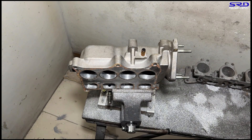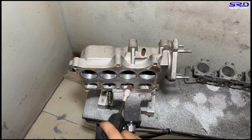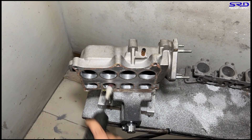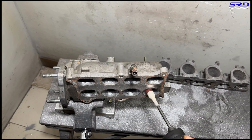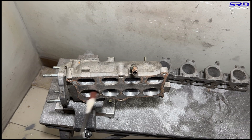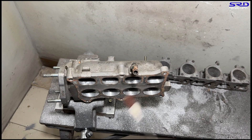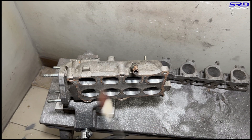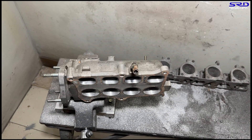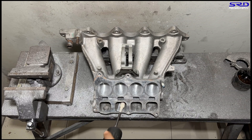This is the shorter runner side on the wide-open throttle section, then we go to the longer ones down at the bottom. Later we'll be porting the rest of the manifold on the long stretch, but we do this first. We invert it to go to the other side so it's perfectly round. It's actually getting smoother and good. Now we smooth out the long side — the longer runners — the ones used for low RPM to mid range. Going with the time-lapse.